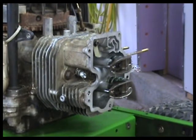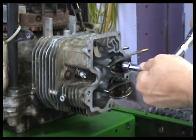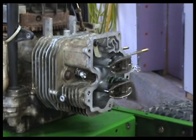All right, now, these two bolts that hold those pedestals on, you set those at 100 inch pounds, not foot pounds, inch pounds, which is, I believe, 8.3, 8.4 foot pounds if you don't have an inch pound meter. 100 inch pounds. Now it's not very much. Eight and a half foot pounds is not a lot. That's it. That's all back together.